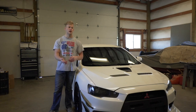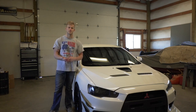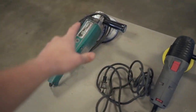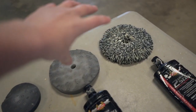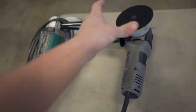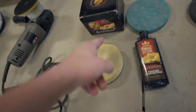Let me show you some of the products I am using. As always, everything is going to be linked down in the description box below. So if you guys want to use any of these same exact products, go check the links down below. So here are all the products I'll be using to detail the car today. I have my two buffers here. That's a high speed buffer for using with these two wheels here. This is a variable speed buffer — it's like a dual action buffer. Pretty much when this is on, this wheel will spin and move at the same time. That's very good for swirl removal and stuff like that, and it's used with these three smaller pads here.